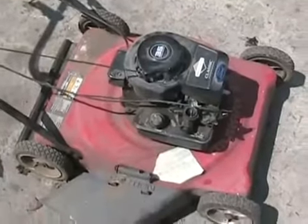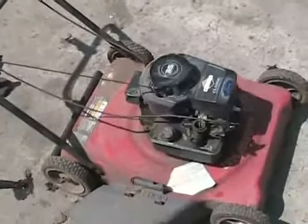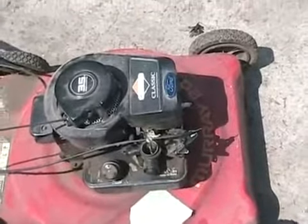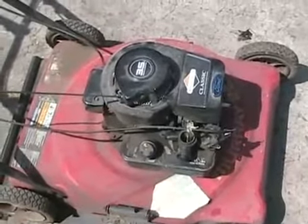Now, if you happen to have a Briggs & Stratton lawnmower that has the choke on it, of course, that would be a plate that you would see there. They start very easily with a little trick. You always tip the lawnmower up and tilt the spark plug towards the ground and hold it for 2 seconds and then start it afterwards. That primes a little chamber that's near the top of the carburetor here with fuel, so that the little fuel pumping diaphragm doesn't have to pump all the fuel up after it sat a while.